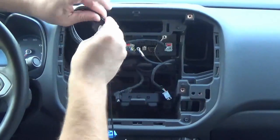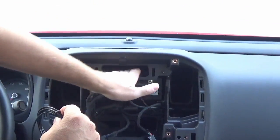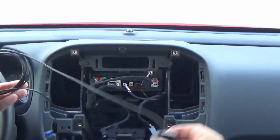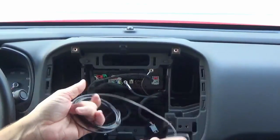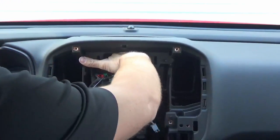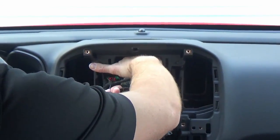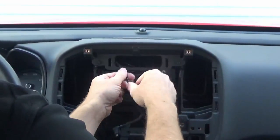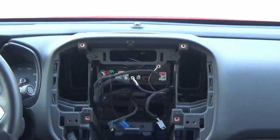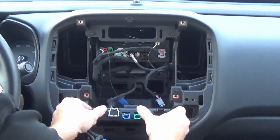Ultimately, you want to get the GPS antenna installed somewhere beneath the windshield. You could pop up the cowl and put it under there, or put it under the little cubby here — it just needs to be under the dash. For this installation video I'll stick it back here; I'll use double-sided tape or find something metal since it is a magnetic antenna. Then just route the connector down.